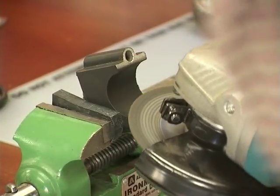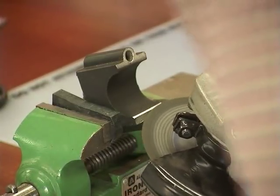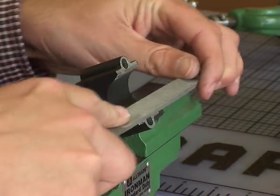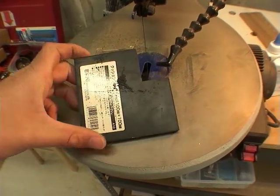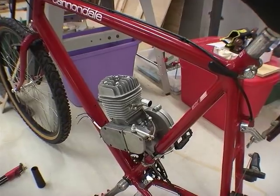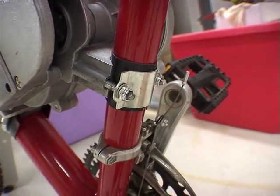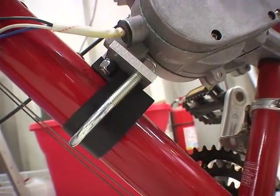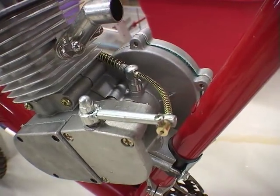One of the mounting parts for the back of the motor goes to the seat tube. First I tried a grinder to grind aluminum, which is a bad idea — it doesn't grind aluminum at all — so then I had to go to a file. The seat tube is about an inch and a half instead of a more standard inch size. I also had some nice thick chunks of rubber I got in Japan, cut them into little chunks to make good vibration-absorbing material for the motor mounts. On the front motor mount you can see a larger chunk of rubber between the motor mount plate and the bicycle aluminum frame — it really helps absorb engine vibration.